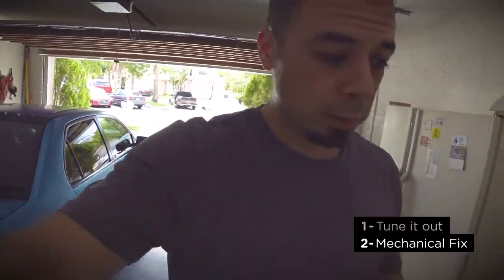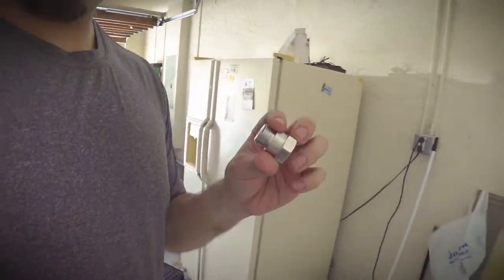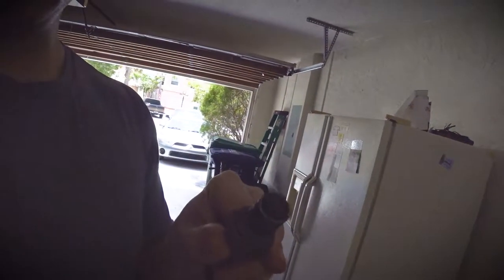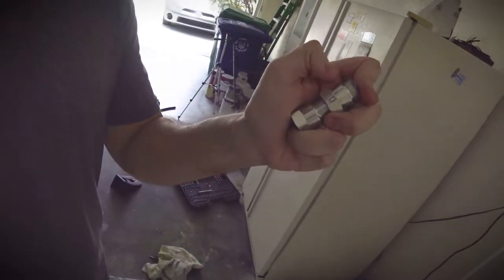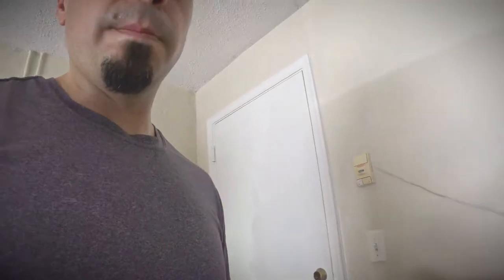These little guys you buy in pairs. What you do is drill out this little hole and make it wide enough for the O2 sensor to go through. Once it goes through, you grab a second one and screw them on top of each other with the O2 sensor set back, then this assembly goes onto the test pipe. That spacing gives a lower reading on the exhaust gases going through the test pipe, so the ECU thinks the cat is still in there and won't throw the error code.